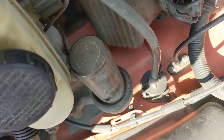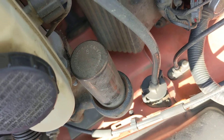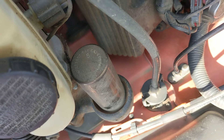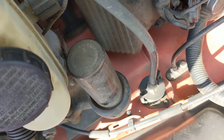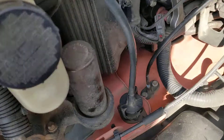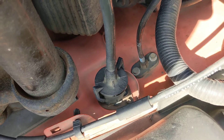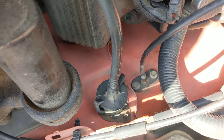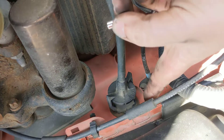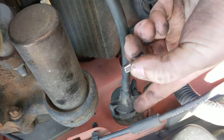Of course, because of who I am as a person, I did leave my toolbox under the car, so back under we go. On an 04 GT, the clutch cable bolt right there on the firewall is a 5 millimeter — that one right there.